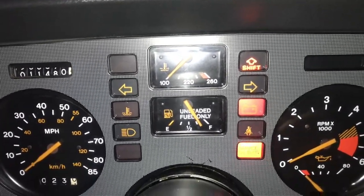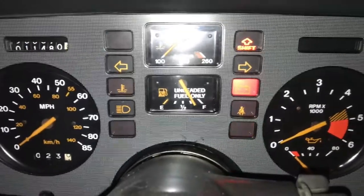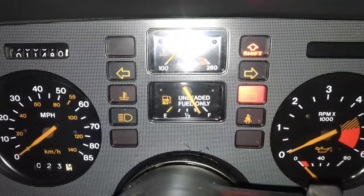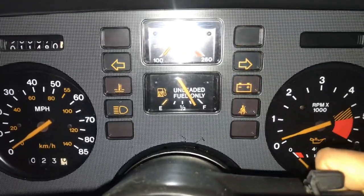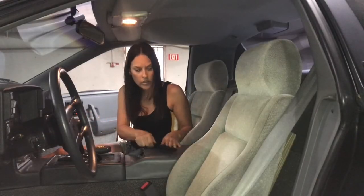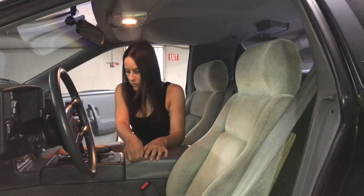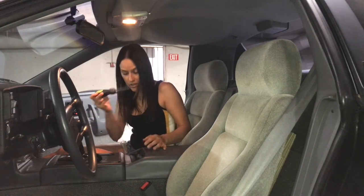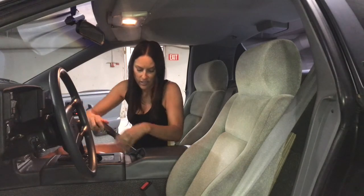I think I'm going to need to look up and see if I have to reset — or how to reset — the codes once you've already done the fix. So I'll have to figure that out. So anyway, we're still showing code 44, but nothing else. And then just to take it out of program mode, all you have to do is turn it off and then pull out the paper clip. Now we're just going to put this back together — take our plastic piece here, put our screws in and start those by hand, then use our star tip screwdriver to get those in.